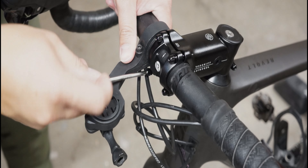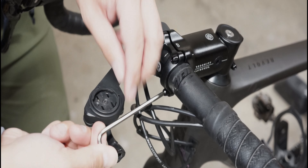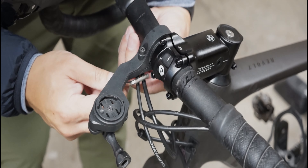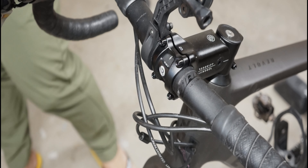If you have a bike computer mount, make sure to get it out of the way and don't be lazy like me, especially if you need space to tighten the bolts for the stem face plate. Also very important to torque things up according to the recommendations.